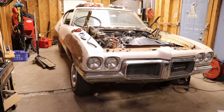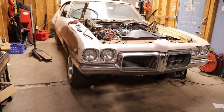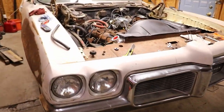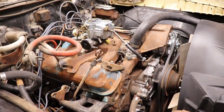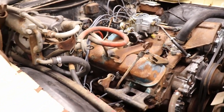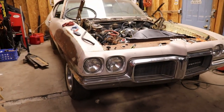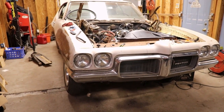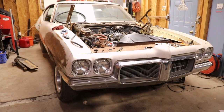So other than that, we do that little stuff, then we can put some coolant in it and fire it up. I've got to install the oil pressure gauge and temp gauge. So other than the brakes, we can put some coolant in it, make sure this thing's not going to run hot, make sure it's got water circulation, and make sure we've got oil pressure. So we should be good. So I'm going to go ahead, get those transmission lines blown out, get the transmission mount up under it, and hopefully we can let it down and hook up that other stuff.